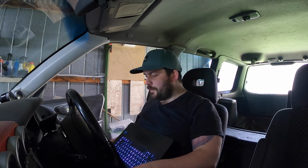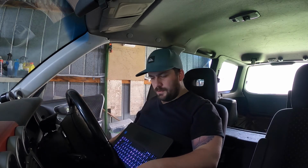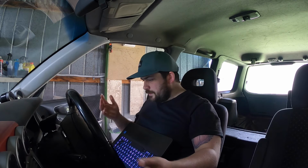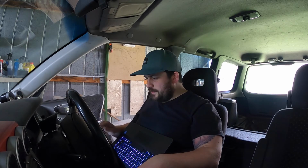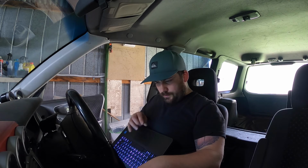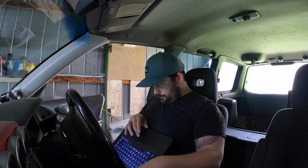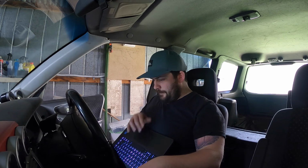Alright, so that run I just got over 4 volts, and manifold pressure up to 17.5. On the gauge it went up to 21, so not sure. This is manifold relative pressure, not MAP. I do have the MAP there as well, so on the MAP it went to 32.5.